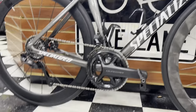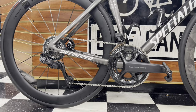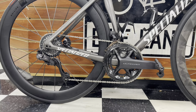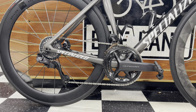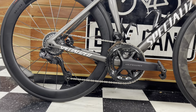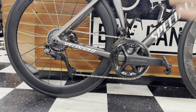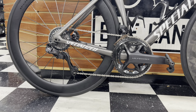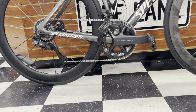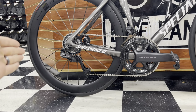I would not recommend this for a daily rider because issues can arise. If you take this setup to a store, even if it was my store, and you're complaining about your gear shifting, my first initial reaction is going to be to make this compatible, Shimano with Shimano or SRAM with SRAM. I would tell you to get rid of that cassette and put a Shimano cassette on there. I don't see the full purpose of it unless you're really looking for that type of gear-specific ratio.